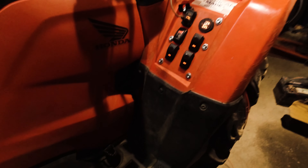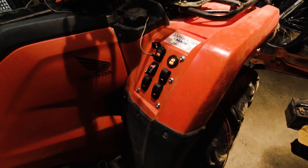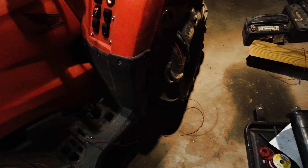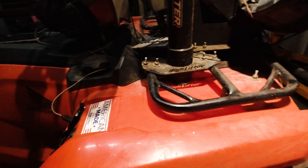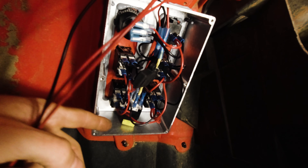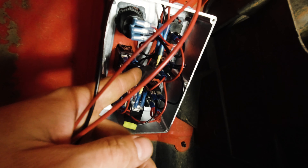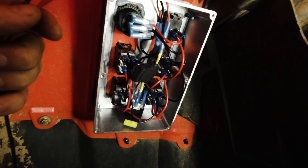We got it preliminarily wired up, just got the wires run into the battery on the outside of the fender. I have to actually run them properly eventually. Here is the back of the panel — the box all wired up. I've got a fused relay in here; I used a 20 amp fuse, and then I've got a fuse for the power line going to the relay with a 30 amp fuse in it.